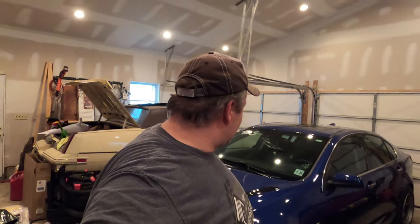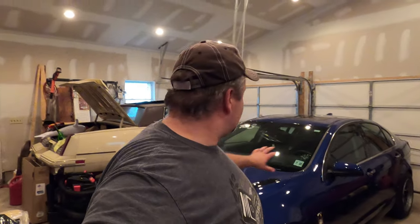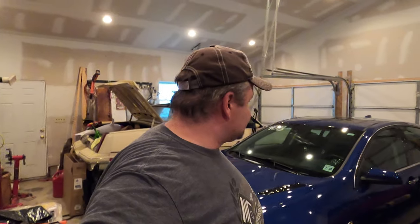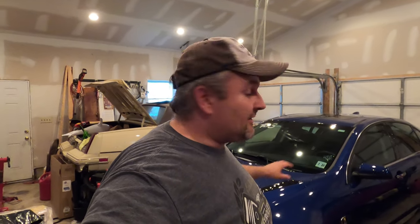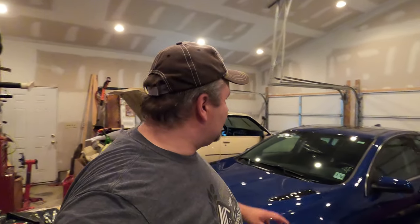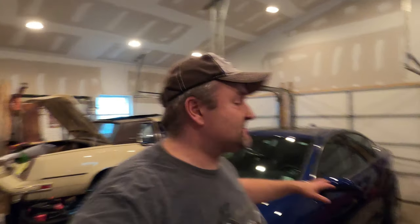All right folks, how you doing? This is Dave, we're back for another episode. So what we're gonna end up doing — I went through, reinstalled the new radiator, bled it, I haven't taken the car for a ride yet just because I want to make sure the trans level is right. Basically 10 quarts plus one and a half — generally these 6L80s have 10 quarts roughly in them, and then for high-performance cars where you're launching really hard — and I'm not counting what's in the converter.